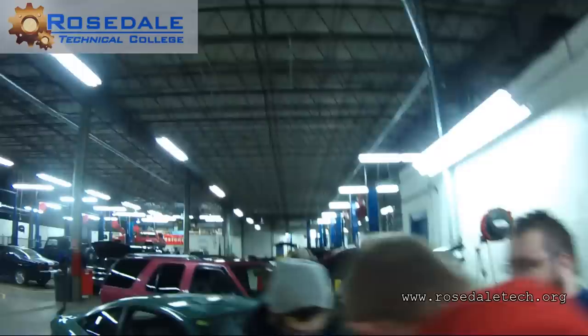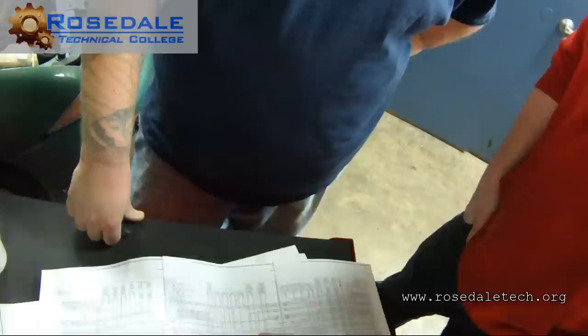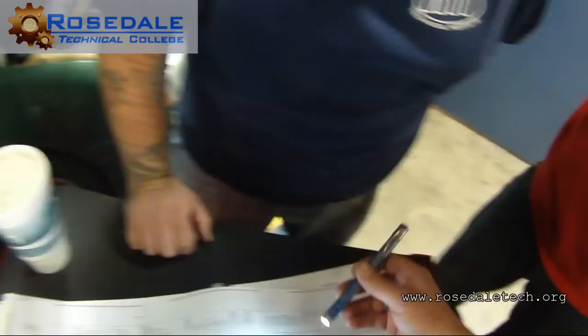All right, so wiring diagram of a coolant sensor. Where's my coolant sensor at? Okay, some tips in reading these. Without looking at the whole circuit, just going down these. That one goes to the computer. Where does this one go? Does it go to a splice? No. This one, that one there. What's it say on that? ECT sense. And then what's the other one say? Same thing.